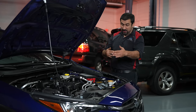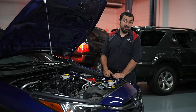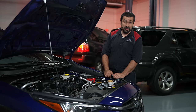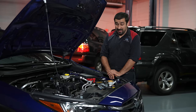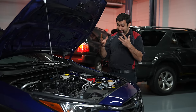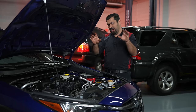Service on this engine requires extreme cleanliness. Because of the engine's orientation, you can actually clog oil passages and cause major damage if you're not careful. Subaru's sealer is very strong, so cleaning it creates a lot of debris — and that's another issue to be aware of when working internally on this engine.